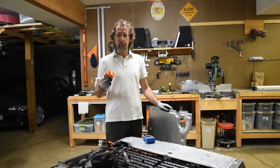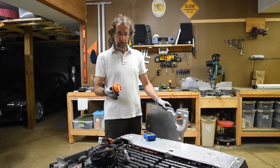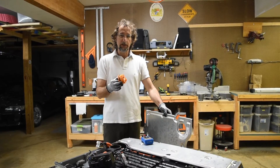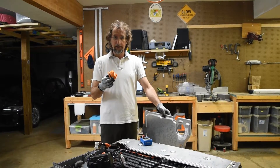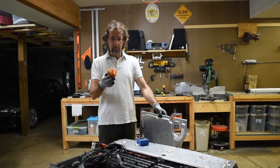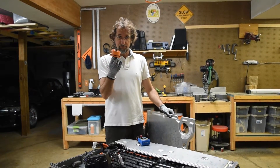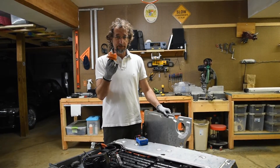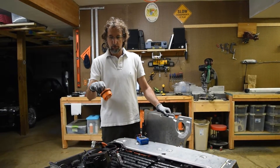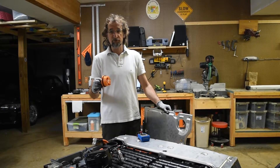This is day two of the 2009 Ford Escape Hybrid battery recharge project. In order to get to the battery, you have to remove the lid — a couple of screws outside. Again, there are some videos out there that explain it in detail how to get the lid off and get the battery out of the car. You need at least two people for this. My wife Linda was helping me yesterday getting the battery out — this is a heavy sucker, about 200 pounds, or translated in metric: heavy. This is the safety switch. The safety switch has to be removed in order to get the lid off. Don't reinstall the safety switch, because it connects the two parts of the battery — the upper and lower part — which then gives a 300-volt-plus charge on the leads.